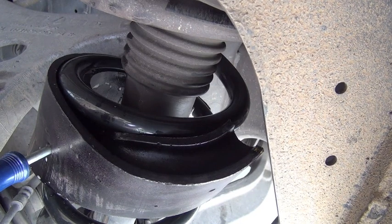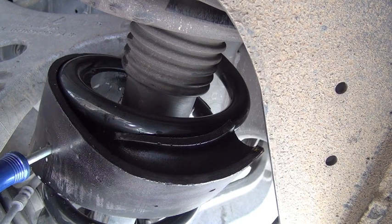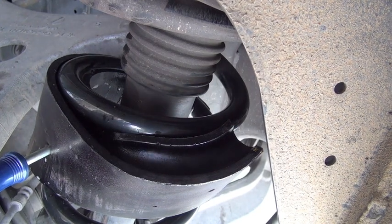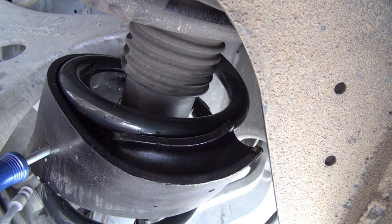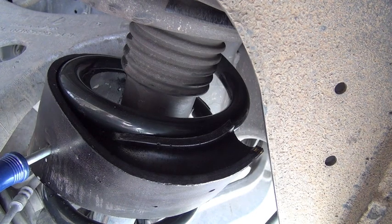I hope this helps anyone doing a larger vehicle. You do need to remove the tire and drop the axle all the way down, even if it means taking off one of your control arms to do so — save yourself the time and energy and just take it off. These things work great and are a great addition to your spring system, especially if you're towing a heavy trailer. I'm not sure how anyone installs these without taking that control arm loose.